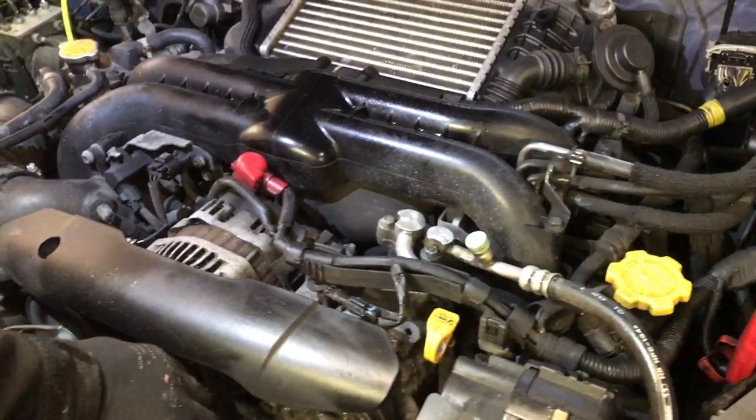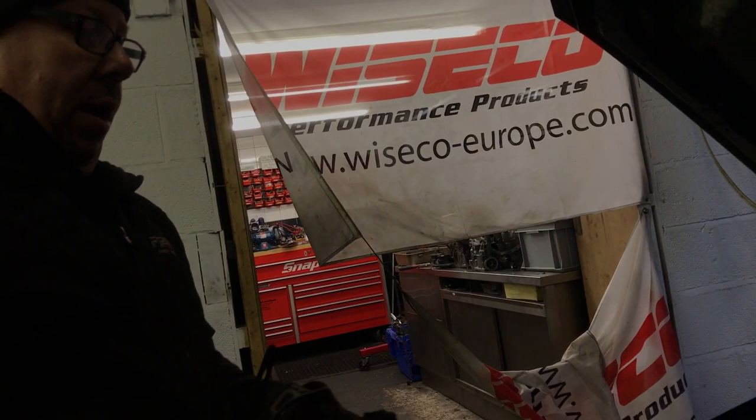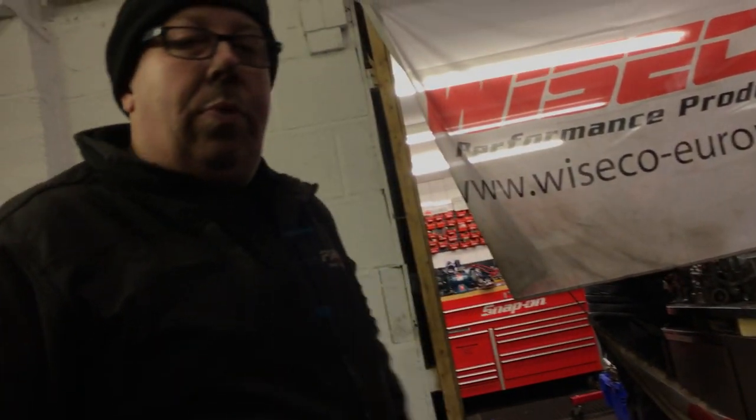So how's the car, the running and everything? It sounds nice enough, seems good. Yeah, it sounds healthy. What do I do in terms of service? What do I service? What do I check? You want to be doing oil changes, really. We tend to recommend every 3,000. Based on general people with their Subarus and maintenance, I'm guessing it needs one.